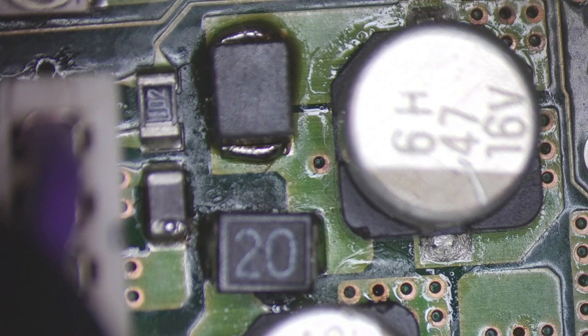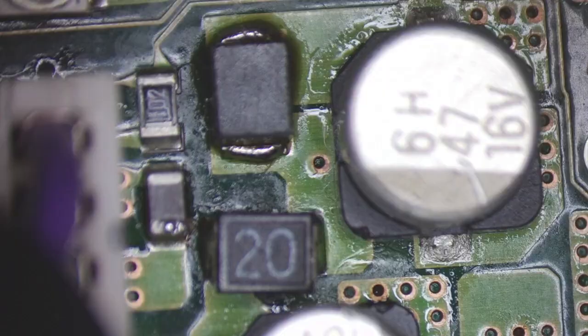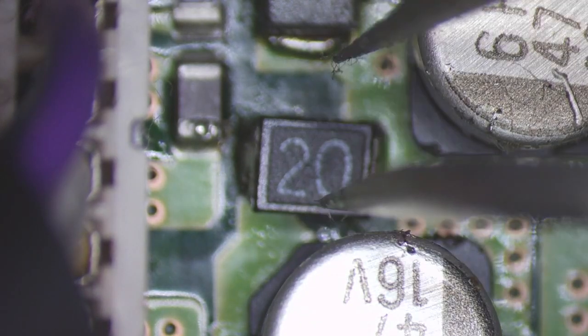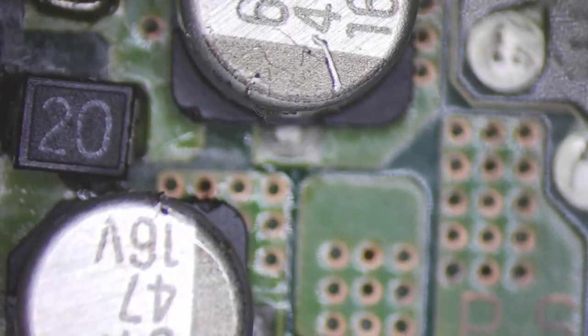So there's the new fuse and the re-soldered inductor. I forgot to press record, or I was recording and for some reason it stopped. All I did — and I've mentioned this a few times — if you add a little bit of low-melt solder onto each side, it remains liquid enough for you to just pull the fuse off with a pair of tweezers. That's what I did, and I've re-flowed that inductor, but I wasn't recording at the time, so I do apologize.